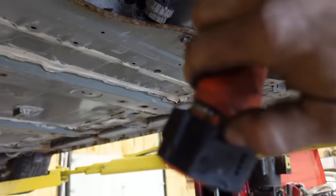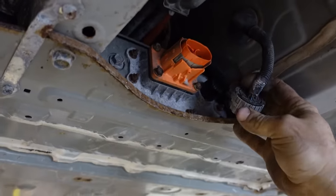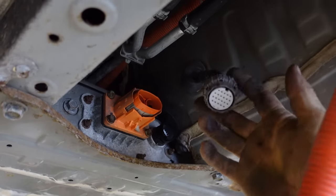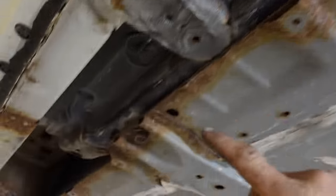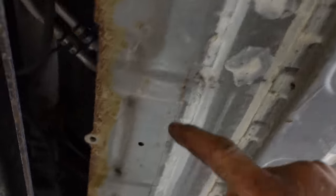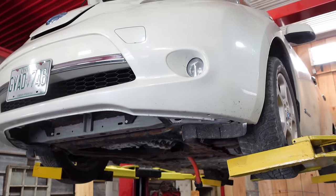So just one plug — pull the blue pin and slide that back — and one other pin. We'll have to change this plug when we go to a bigger battery, and then just a couple of bolts in the frame: one, two, three, six, seven, eight — I think eight bolts. And the battery's down. It's like the quickest fuel tank drop ever.